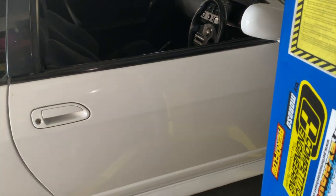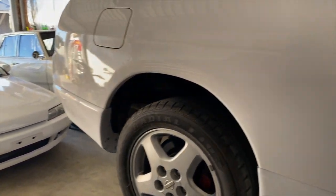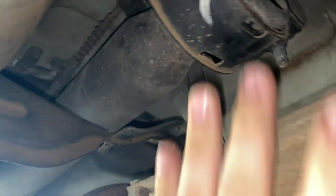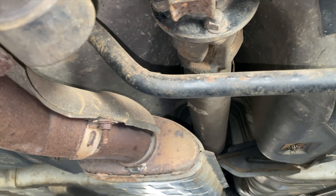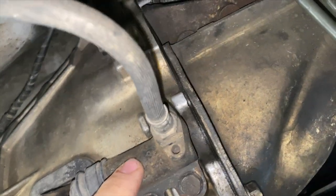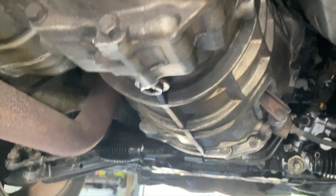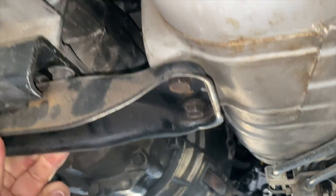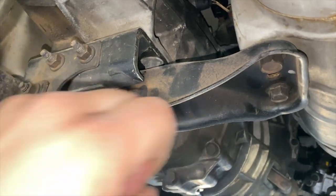Once you've removed all of that you're going to put it back up on the hoist. Once you're down underneath, first thing you need to look at is will your exhaust clear — this one runs straight underneath. I have pulled it out before without pulling the exhaust off and I will try to do it again. We'll just unbolt the tail shaft bolts at the diff and center bearing. I leave this in so I don't have to drain the transmission oil — just throw a strap on it and pull it back onto the gearbox. Here are your electronics, all of your sensors, slave cylinder, and the ring bolts that go around the transmission holding it onto the back of the engine. Last thing, put the transmission jack underneath and take the four bolts out for the transmission cross member.